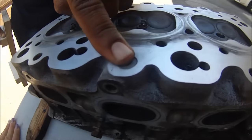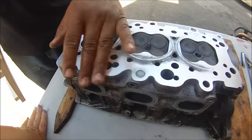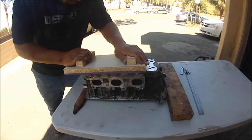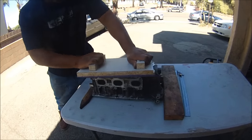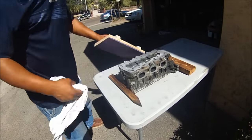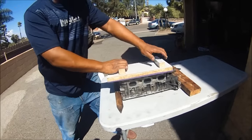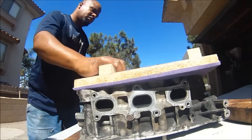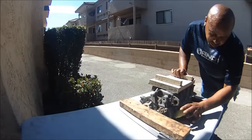These are the maximum amount that you can resurface this head down. We've got plenty left here — see that? There's plenty left, so let's keep going. Notice I've got this one set further in than this one — this is my grip. The pull and the push. Every once in a while, dust it off, then go at it again.